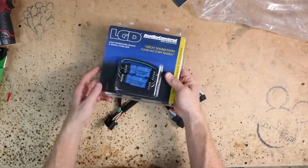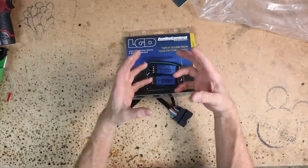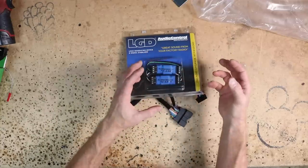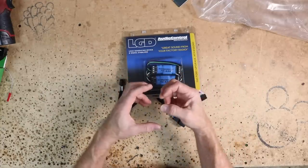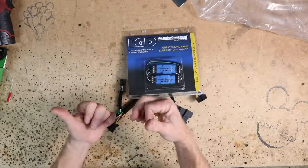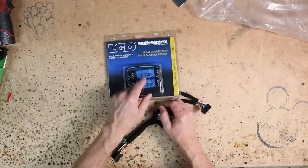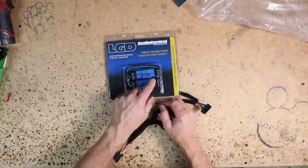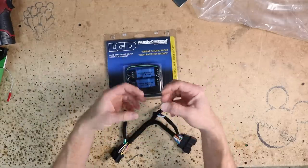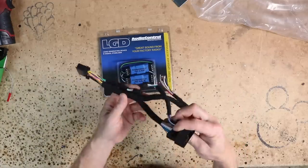One other thing we'll need for this install is these AudioControl AC-LGDs. Because this is a newer vehicle with a more modern amplifier circuit, they look for the load coming from the speakers in order for the amplifier to perform properly. High level sections typically don't have loads. So we need something to condition that factory output so it doesn't go crazy. Specifically in the Ford, if you don't load down the output from the factory radio, the high frequencies tend to get a little wild. The AC-LGDs are a Zobel load network designed to put a small amount of load on there to keep it sounding nice, crisp, and clean.